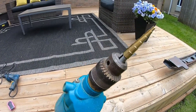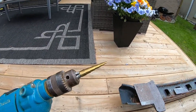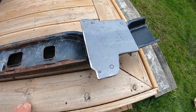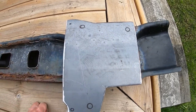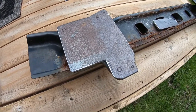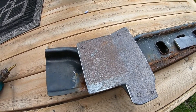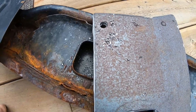Now we're going to drill with the step bit. I have a lot of experience trying to drill through these plates with step bits - it does work but takes a long time and is a pain with battery power, so we have a plug-in power drill. You can see where all our marks are for the holes - the two main ones for the 13 mils, and the others for the T30s or T20s. We're going to be doing the holes - this step bit goes to a half inch which should be more than enough. There's the first hole done.